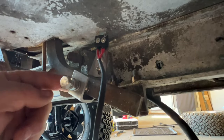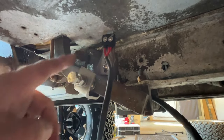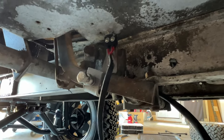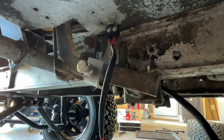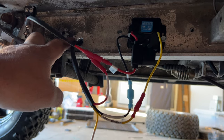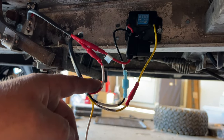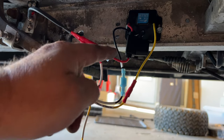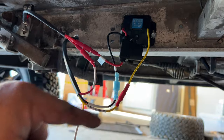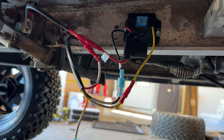I have the J mount installed here. Still need to tighten this nut into place with that lock washer so it doesn't move. Up here you can see it's resting against it. Right now these two wires do not have continuity, but as soon as we hit the brake pedal, that switch opens up at the very top and we do have continuity — that's exactly how that works. I went ahead and found a hole in the side of the frame, drilled it out just a little bit with a Christmas tree bit, and ran the wires from the main harness over so I don't have to run them underneath the frame. Red wire out of the main harness goes into the brake switch, out of the brake switch, into the brake switch relay. Then black from the relay goes into the harness, and yellow from the relay goes into the harness.